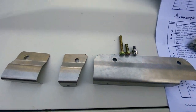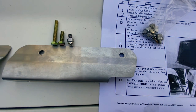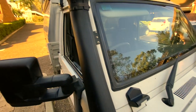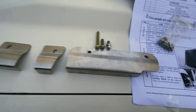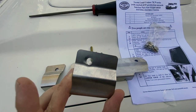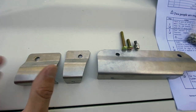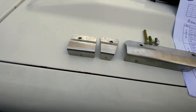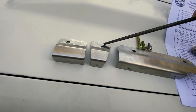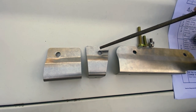These are the brackets it comes with. The two shorter ones are for the driver's side and the longer one is for the passenger side — the reason they're split is to get past the snorkel mount. Because this is for a 79 Land Cruiser, I've just elongated the holes slightly on all of them to give a little bit more room.